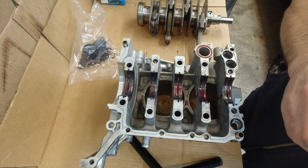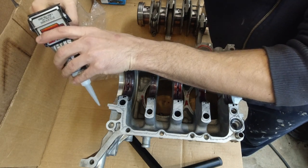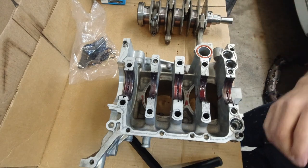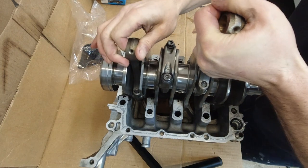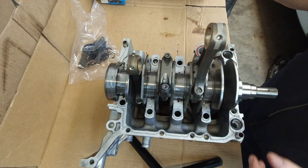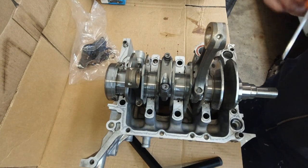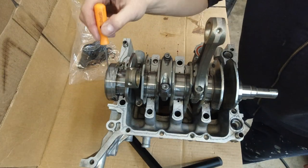Should be good, I think. Let me go another line here. Probably didn't have to do this part. Now it's time to drop in the crank. This area here is critical — you don't want to go too close with the silicone to the crank. That's why I put a very thin, small bead of the RTV right there. Now I'll try to balance and lower the rods down.